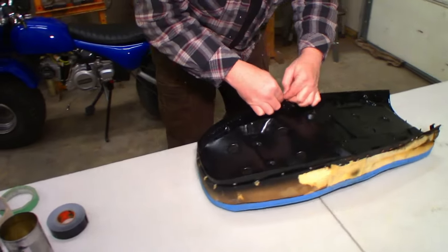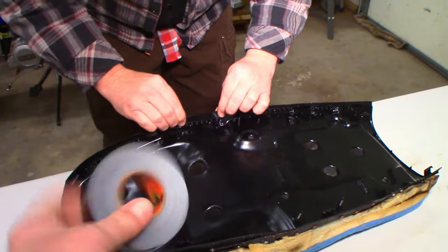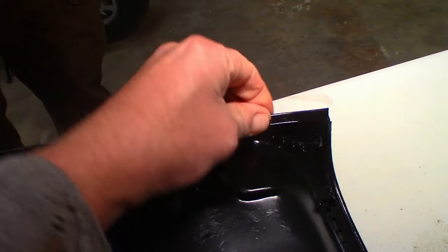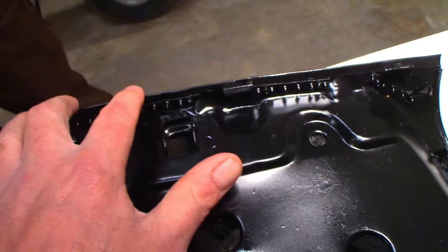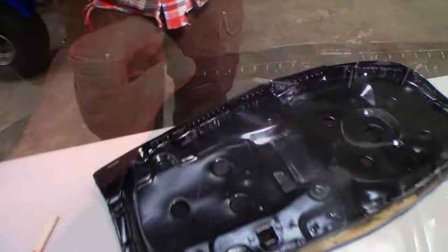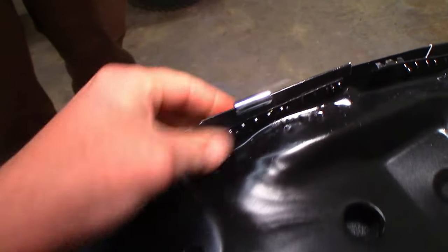So what are you doing? I am putting some Gorilla Tape on this edge to protect it. I didn't know they made Gorilla Tape in that size. Okay, so we're putting the Gorilla Tape around the metal lip here, so when we pull the vinyl across it, it gives it a little bit of cushion, so over time when you're rubbing back and forth like this, it won't tear the vinyl. Yeah, that's a lovely idea. That's looking good. Let's see if our little chrome trim is gonna fit over that. Oh, that's gonna be lovely.